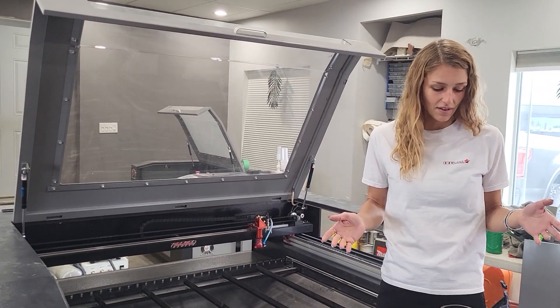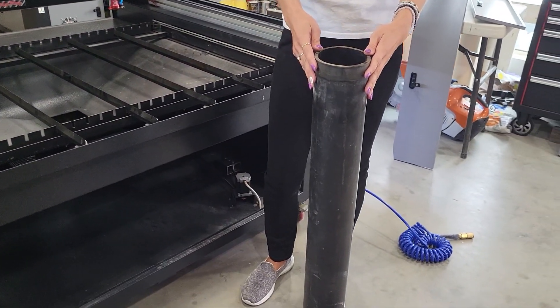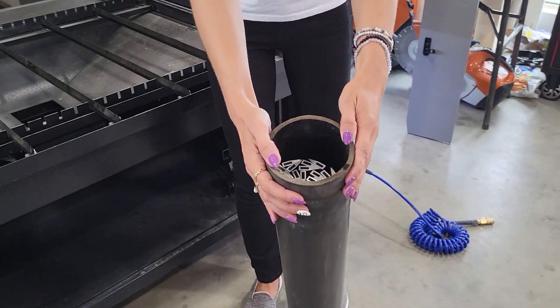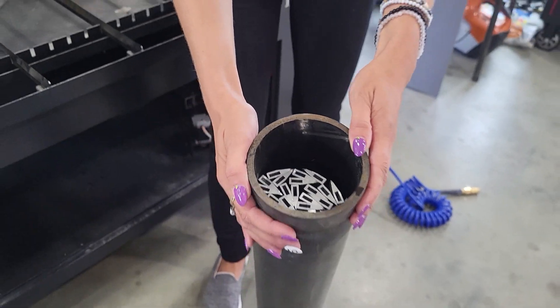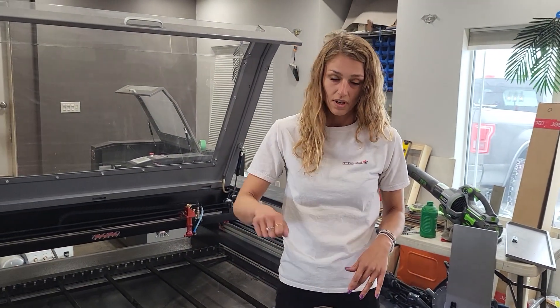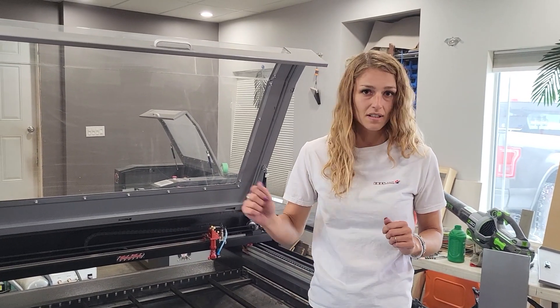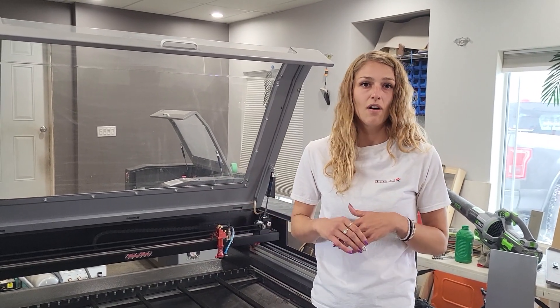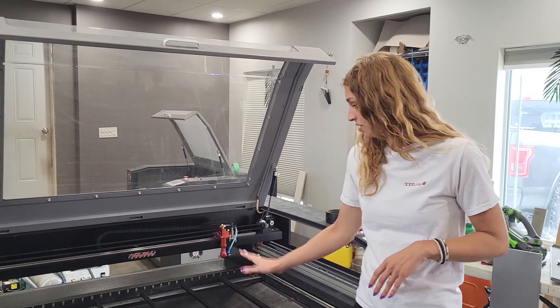The first thing you can do — something that Ray did — is get a really big piece of ABS pipe. If you take a look inside, you can see that we can fit all of our blades inside. Go ahead and get a bottle of white vinegar, once your blades are inside dump the vinegar in until it fills up, and leave it there to sit. It will wipe off all the grime and burning right off your blades.